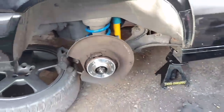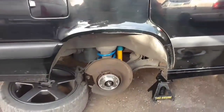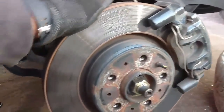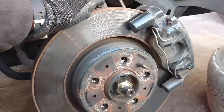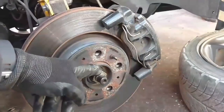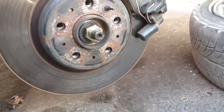Replacing the rear bearing. Then I'm going to replace the front one because I think it got damaged. Let me get the torque wrench, torque this down. Process of replacing this wheel bearing, because when I did the CV axle on this side a few months ago, the axle bolt came loose after about 10,000 miles. And the mechanic said if this axle bolt was loose and didn't have the proper torque on the bearing, that it more than likely destroyed the bearing.